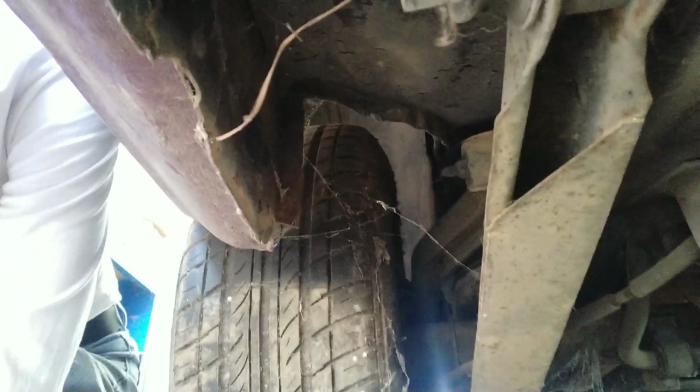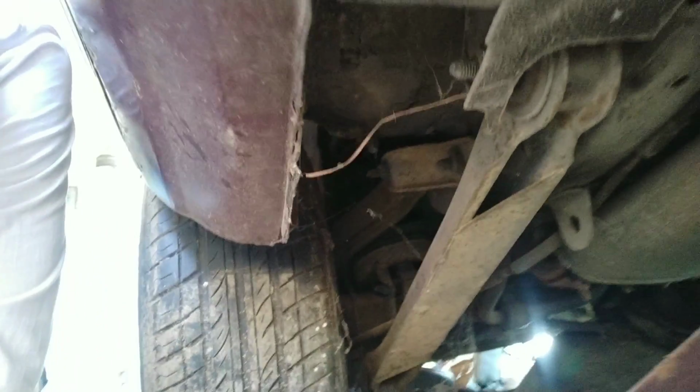I actually don't know if we can see anything on the Fairlane, but if you look at the suspension on that thing over there, and then we go look at the ZL, you'll understand what the component difference is between the two. This is a coil rear end. This is not leaf. This will probably need a rebuild of the suspension stuff. I don't think we can see anything, not realistically, but it's a coil. There's no leaves in the rear.